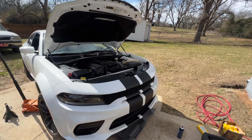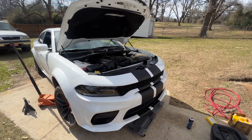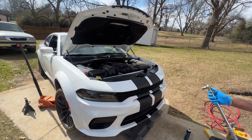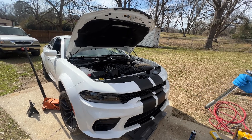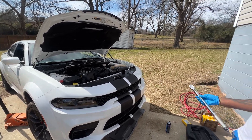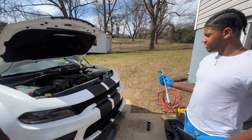We're done with the oil change now, so I'm going to cut it on and look at the oil life — it should be updated. For y'all that want to know about the torque on the drain plug, it was 25 foot pounds of torque that we used on the drain plug to tighten it up. It was kind of like hand tightening, really, but we put the torque wrench on there just to be a little safe.